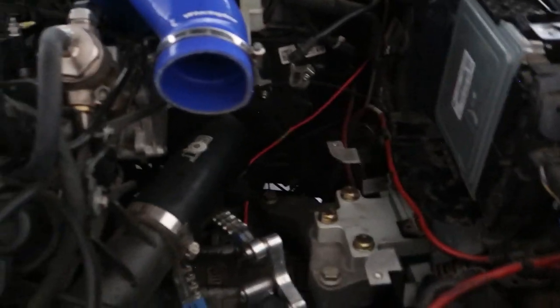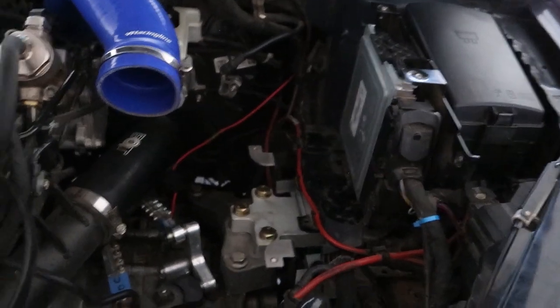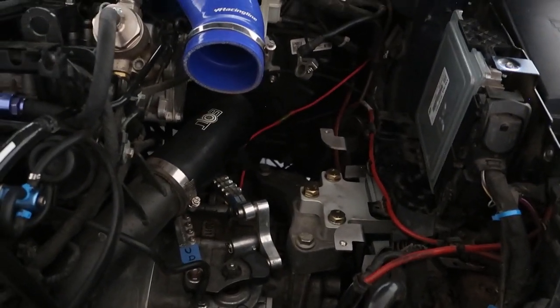Both of them are in now. With the bottom piece, once you pop the ECU out, the top bracket — I just swung it around, tucked it to the side, pop it up and you're good to go. You don't have to split it open. Put the battery tray in, then the battery, then the intake. Old mounts were 72A durometer and these are 85A, so it's a pretty significant stiffness upgrade. Getting a little more race car mod by mod. It's starting to rain — here's the first start, let's see how it goes.